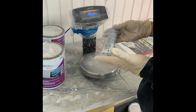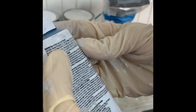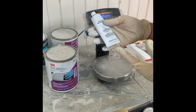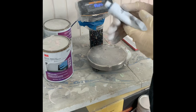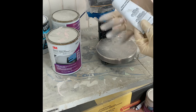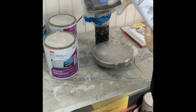One reason we put epoxy over bare metal before we use filler — the biggest reason — is probably if you look at the ingredients in the activator: benzoyl peroxide, water, benzoic acid. There are lots of things in there that you don't necessarily want over bare metal. Epoxy, unlike urethanes and spray polys, does not breathe — it will not wick moisture in and out once it's totally cured. That's a huge reason why we use epoxy before filler. Also, in certain conditions, if you're not weighing your filler and you get a hot batch, that filler is going to get hot as it dries, and depending on panel temperature, humidity, and lots of variables, issues can happen.